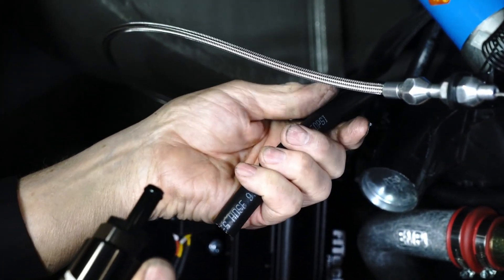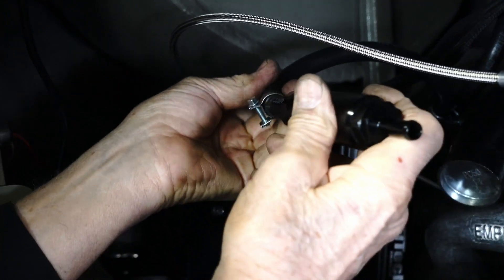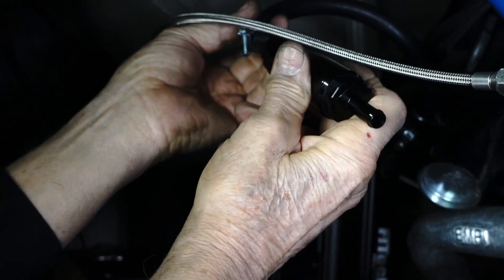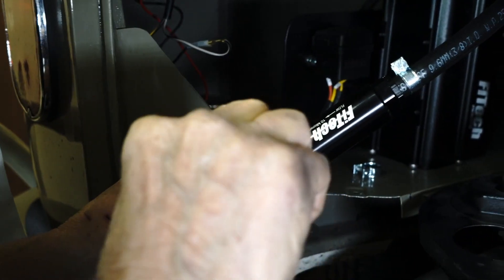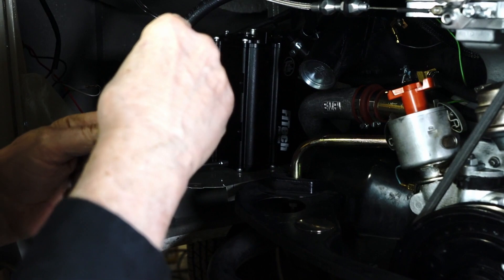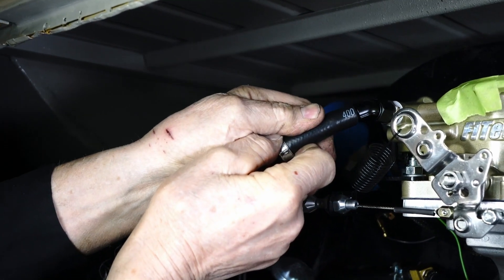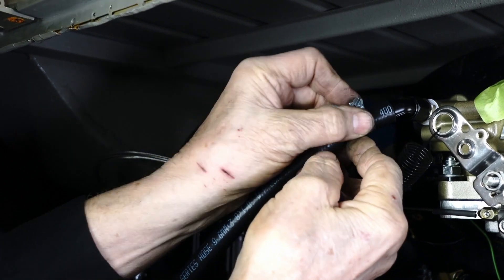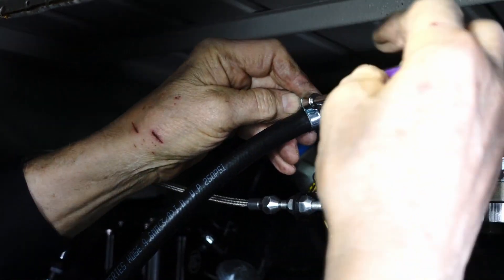In this line, we're going to install a high pressure 10-micron fuel filter. Being that the force fuel mini has a fuel pressure regulator built directly into it, that is why we can get away with hooking a single line up to the throttle body.